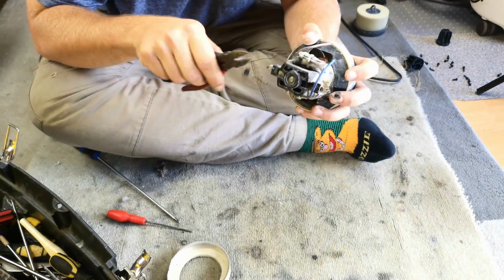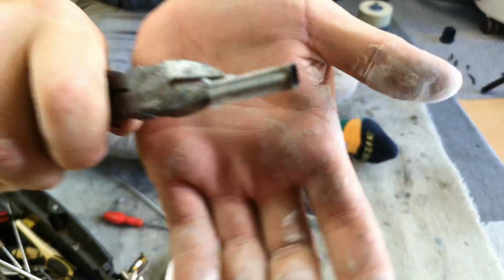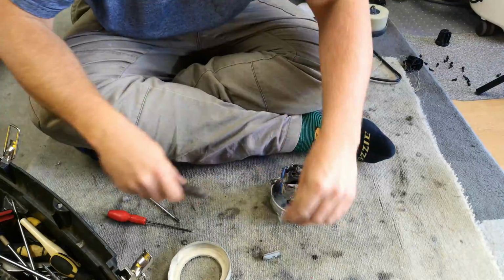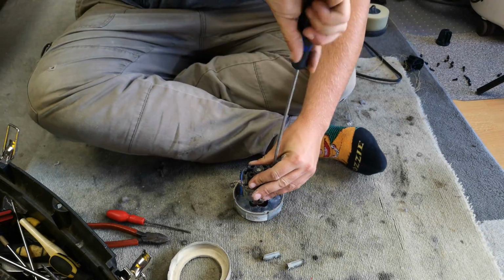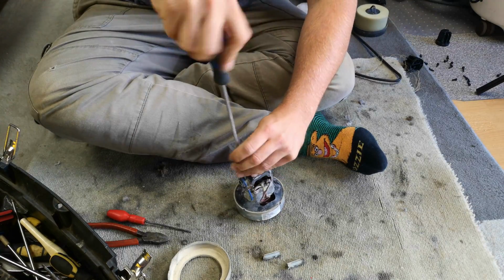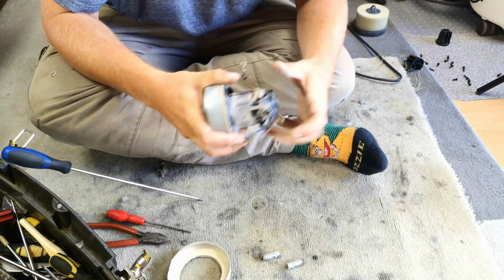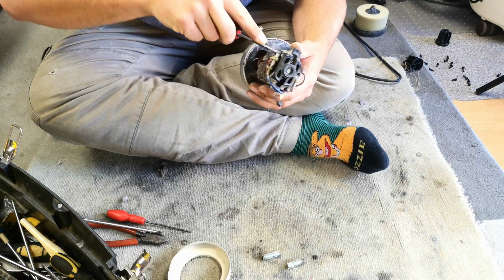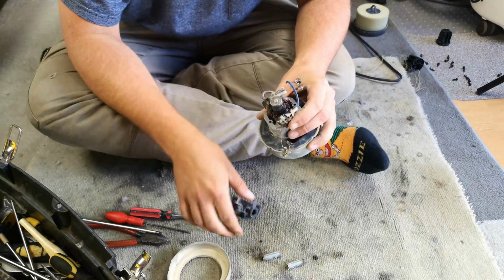So we have carbon brush issues. The next thing that we do is pull out the quite blackened carbon brush holders. So it gives us access to the two little screws, which are right down in there. There we go, and then a little bit of persuasion. Something will give first, whether it's this end. There we go, this end cap just needs to be sort of persuaded off the bearing, and up it comes.